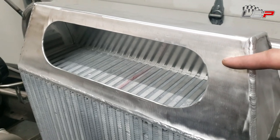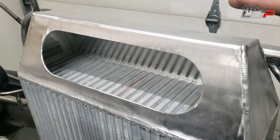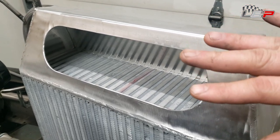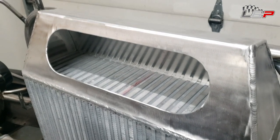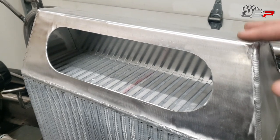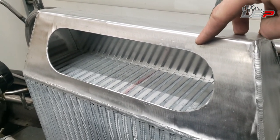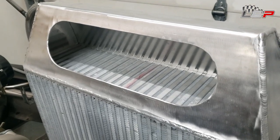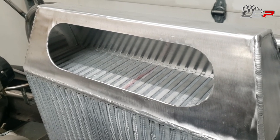Now, this material is 1/8 inch aluminum, if you remember from the episode when we made this cap. So theoretically, I could thread into this and, pressure-wise and bolt strength-wise, I'm not going to have any issues. If you do the calculations, there is more than enough strength in this aluminum material, even at 4 threads deep or 3.5 threads deep, to support 50 pounds of boost at 25 different screws.